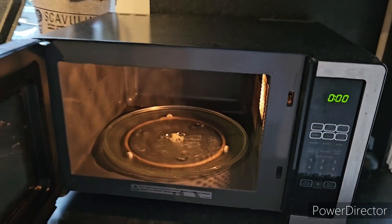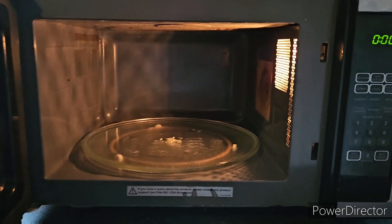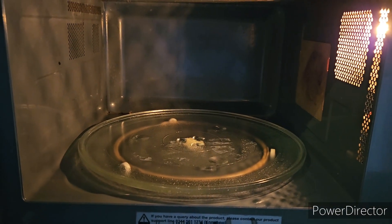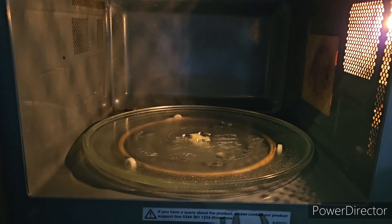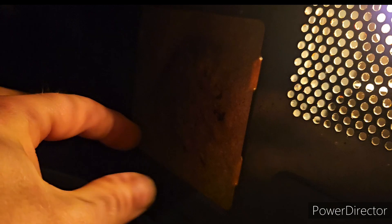So how does the magnetron actually release the microwaves into the cooking chamber? Well, using wave guides — which are usually metal rods attached to the magnetron — it releases those waves into the cooking chamber. Inside the microwave, as you can see, this cover on the right-hand side is the wave guide cover. The top piece up here is the antenna from the magnetron, and the bottom piece is the cavity which is the wave guide that allows a flow of microwaves into the cooking chamber.